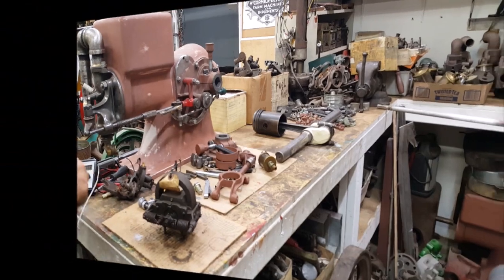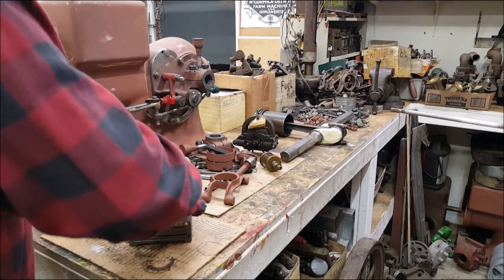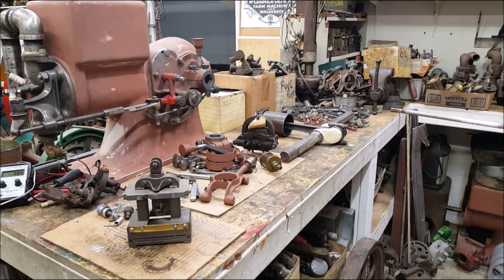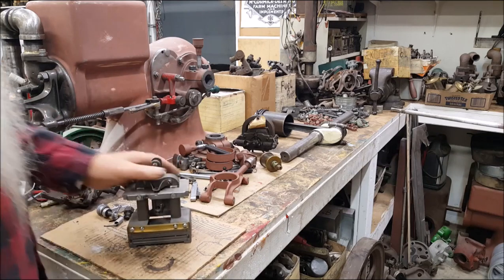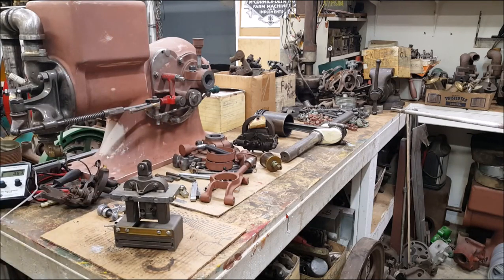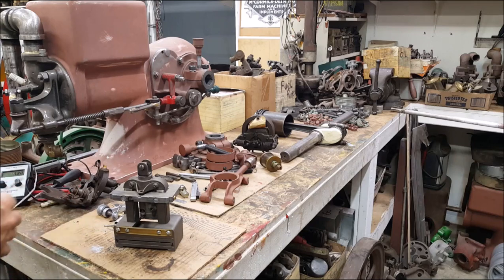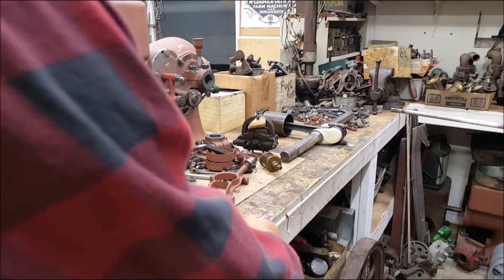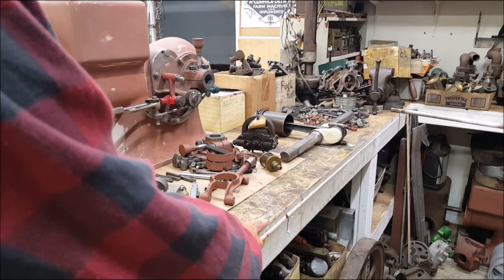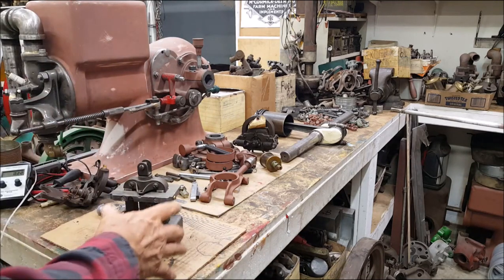Okay, we'll go back over here and see what we got. That's an EK frame. It's been on the shelf for many, many years, in the state it's in right there. It's upside down. It's an EK frame, and my meter's still on 0. So let's see what kind of gauss we got on this thing at the magnet, right down here. Right there I got a minus 72.30. On this other side over here, I got a 72.42. So that's the difference in the reading.